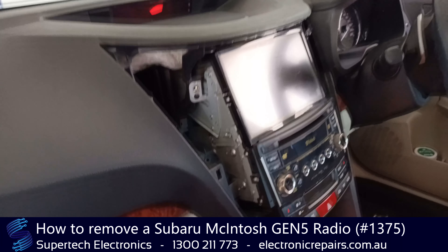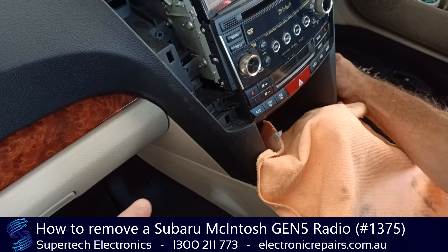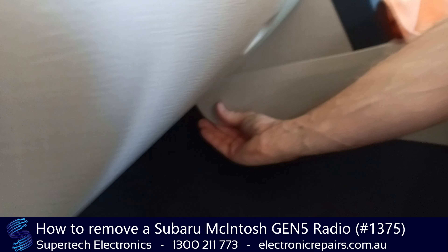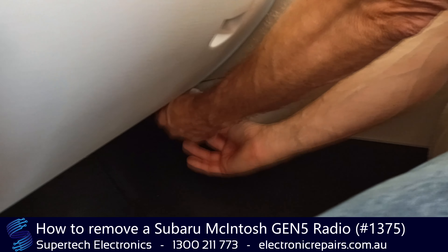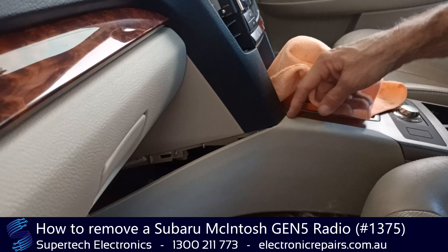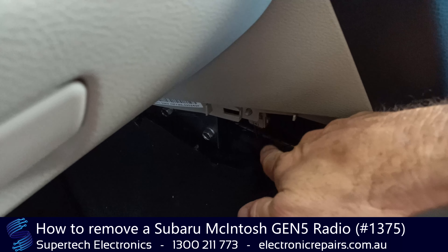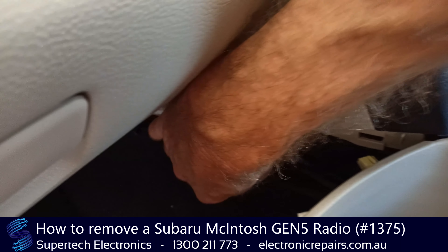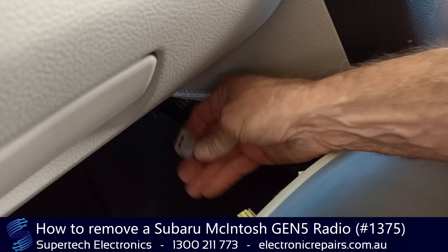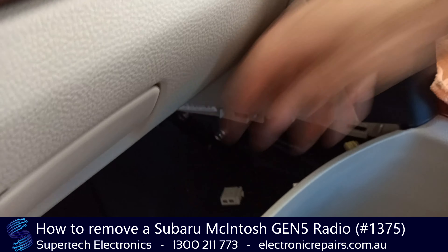There's one cable that plugs in down this side and the same cable that plugs in on the other side. We're going to remove this quarter panel here just by pulling on it like that. Don't lift it too much further back than that because this part is still attached. This is the plug you need to unplug on this side — it just pulls down. There's a little lever to help unplug it right there, and that can just sit there for a second.